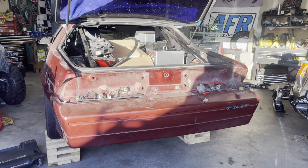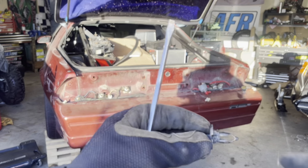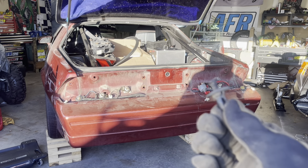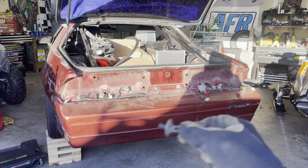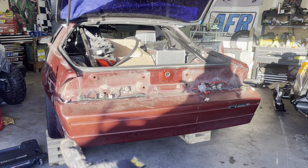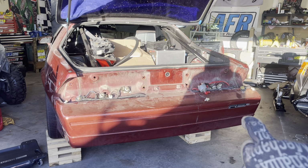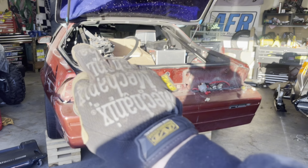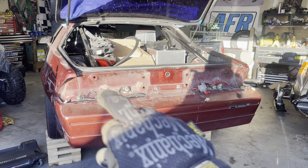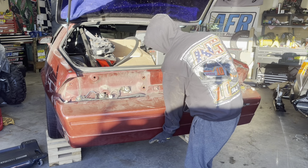Pulling this rear bumper is actually pretty straightforward. If you've ever pulled the front bumper, it's pretty much the same thing. It's a bunch of these little pop plastic holders, or rivets. I think there's 5 or 6 on the bottom. There's 2 7mms in each corner that go to the quarter panel, the valance piece on the quarter panel. I don't know if you guys can hear me because of the wind. Anyway, then there's 3 10mm nuts inside the license plate cover, and then obviously take the lights off, and then the bumper theoretically should come right out.